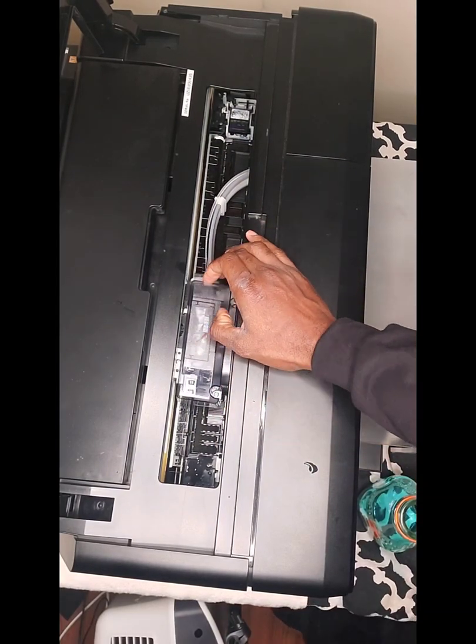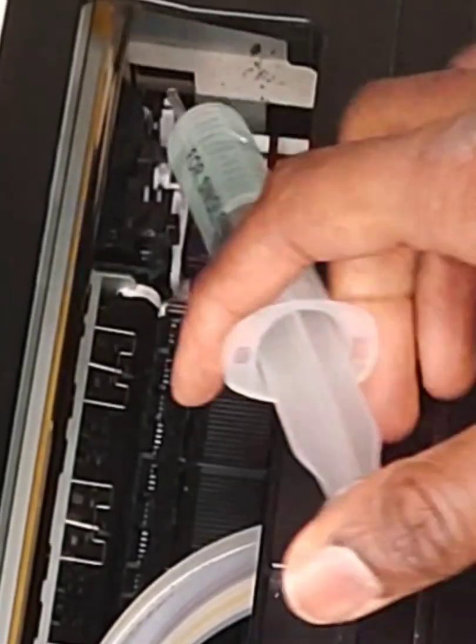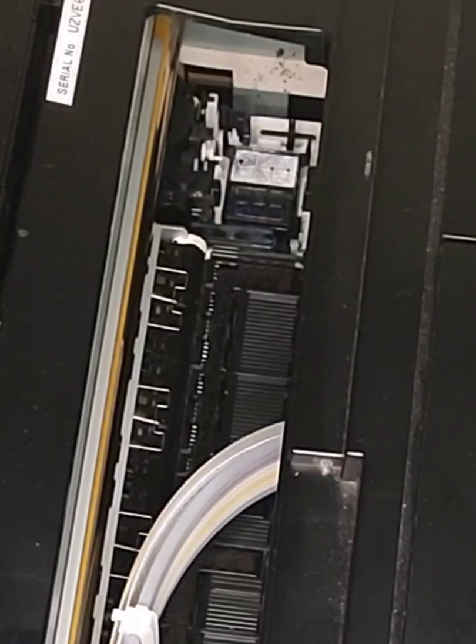Now we take care of the wet capping station. Depending on how thorough you want to be — I'm doing this today but I don't usually do it unless I'm not using the printer for a while — you can put a little water in there just to loosen up the ink a bit. But the most important thing is your wiper blade. Use the release crank until that wiper blade comes out — there it is. Make sure you clean that up.